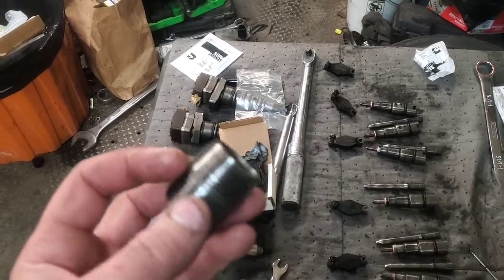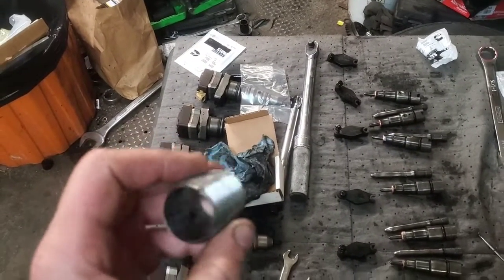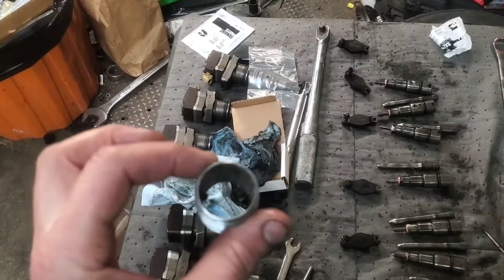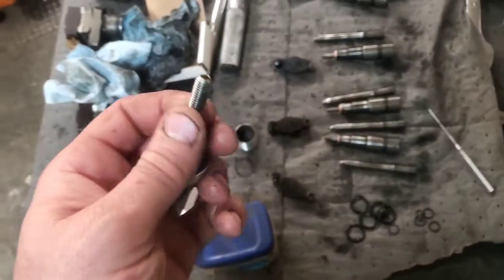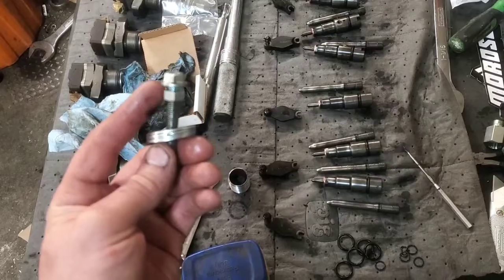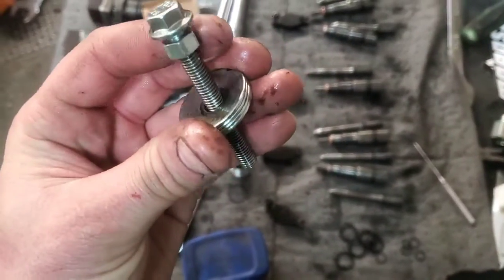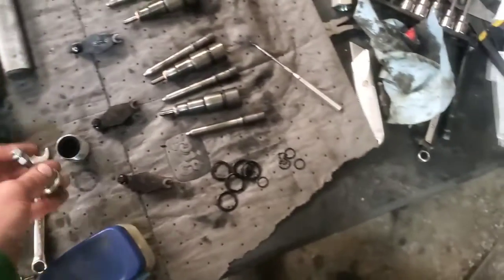That right there made the job super easy. One-inch by close threaded pipe - it doesn't exactly have to be something like this, it could just be some sort of a piece of metal stock, but this is exactly what fit and it fit really really well. Then you get your 8-millimeter by 1.25 bolt or all-thread, thread that in there, then you've got your nut and some kind of washers just to push down on that - probably something thicker than these fender washers, since these have all cupped now.